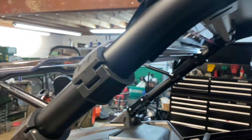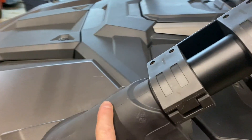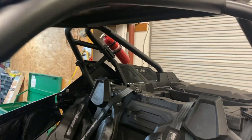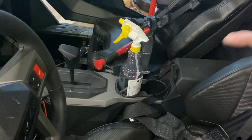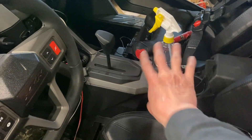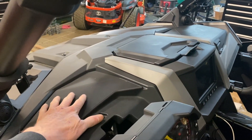On this particular razor I ended up using both sides of the roll bar. I ran all my rock lights to the rear through the roll bar and out the bottom tube section. At the very back tube section there's actually a little gateway — similar to the ones on the sides — that lets you run wire from here all the way to the back of the machine. Also worth noting: the center console on this version is super hard to disassemble. On previous versions you just took out a couple of bolts and some push pins. On this one you have to take the sides off — it's actually built as a hoop assembly — so it takes quite a bit of work.